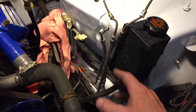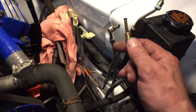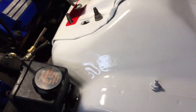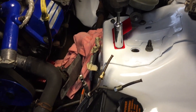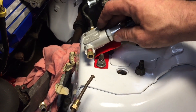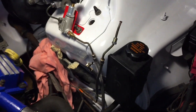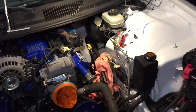I'm using the original lines coming off the body — all I did was trim off the ends, take off the original fittings, and put my fittings on. Here's my custom bracket that I made to hold the proportioning valve. Got the rear brake set up, just gotta throw this one on for the front brakes. Another step bites the dust.